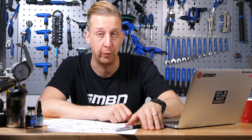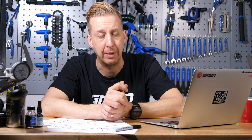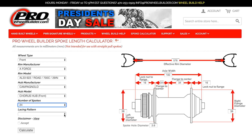The best thing to do is either go old school with a formula — you can go to Sheldon Brown's website, which is a huge resource and has the formula there. You'll need to work out your measurements using digital calipers to measure the distance between your hubs, the size of your flanges, and the distance between them. That will calculate spoke length down to one millimeter. Alternatively, go to prowheelbuilder.com — specifically their calculator page — where you input your rim selection, hub selection, spoke count, and lacing pattern (two, three, or four cross). If your particular rim or hub isn't listed, you can input your own measurements. It's really accurate; I've used it several times. I'll put a link in the description below.